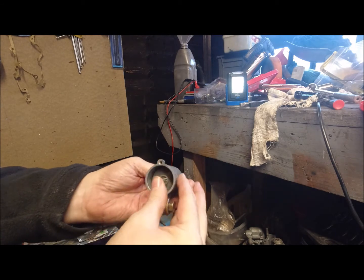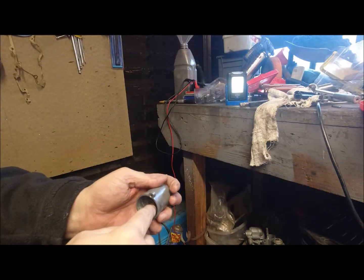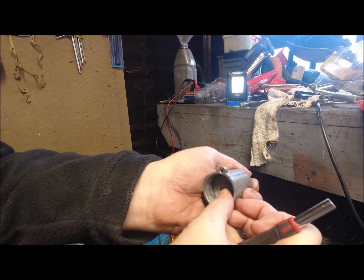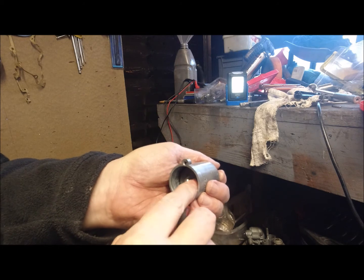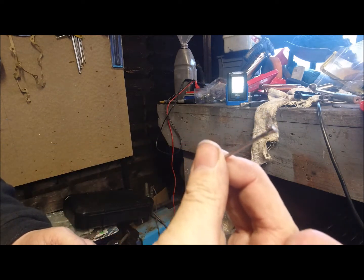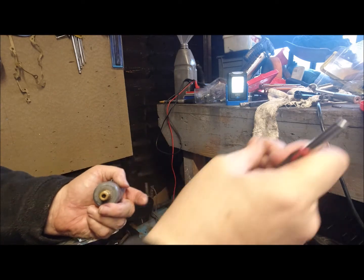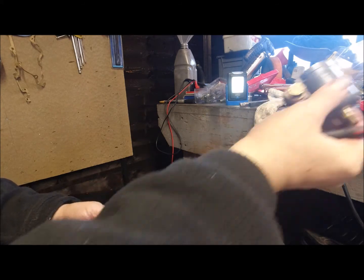And if we push our jet through our needle, I can just use the open-ended part on there. There we go. I'm just pushing that needle through, and it should then come out the bottom. There it is. And it's a funny shaped beast, and what that's acting on, it just stops the fuel there. It acts as a valve that's floating on this float.